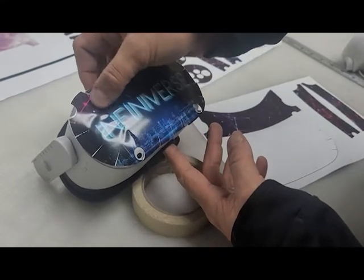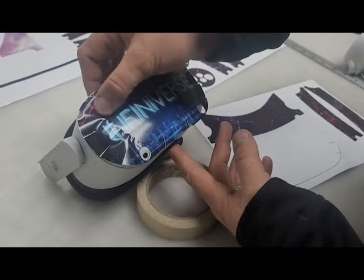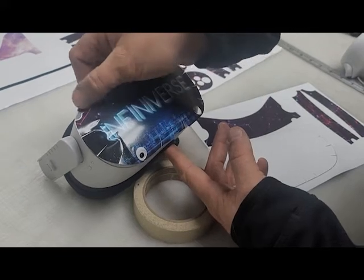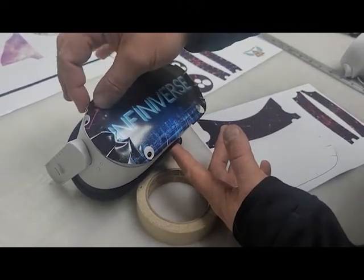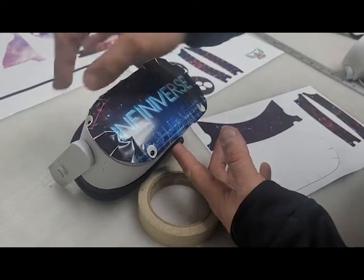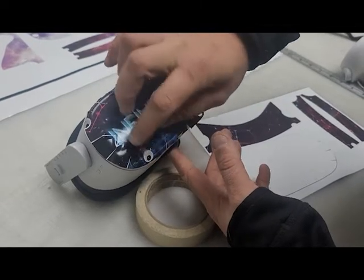You don't need to apply heat, but if you get to the point where you do end up wrinkling the whole thing and it doesn't look very good and you're thinking you have to throw it away, just pull the wrap off slowly — don't tear it. Then you can flash it with a hairdryer very fast and it will reset back to normal. This is a high grade quality vinyl and it's really nice to use.